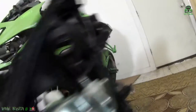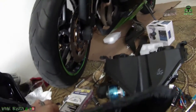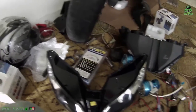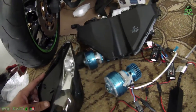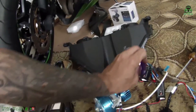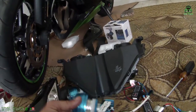This is the worst part — getting this headlight assembly apart. Kawasaki unfortunately didn't use butyl rubber sealant, which is what most people use on lights and which heats up and is easily removed. I put it in an oven at 200 degrees for 10 minutes and it didn't hurt anything, so I'd suggest that. Otherwise I just took a screwdriver and pried it apart all around the edges. You'll want to get butyl rubber to put it back.